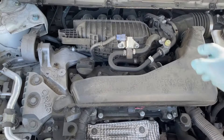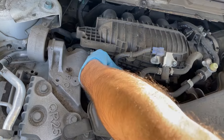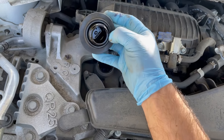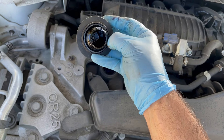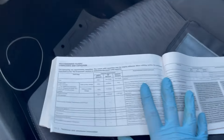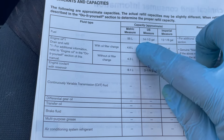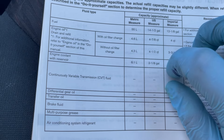Under the hood of the car, you're going to find the oil fill cap here, a little to the left of center. Just like on the oil filter, there's a rubber gasket right here — you can feel free to lube that as well, not the threads. Consulting the owner's manual, we can see that we're going to use 0W20 oil, 4.6 liters with an oil filter replacement. If you're not doing the oil filter, just 4.3 liters.